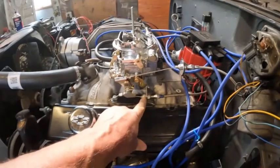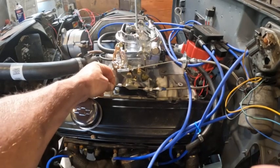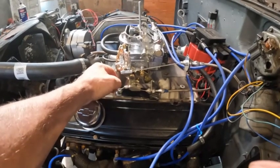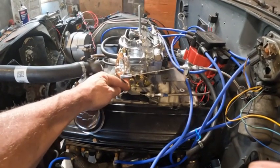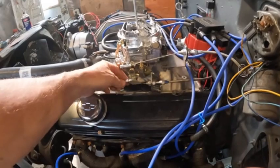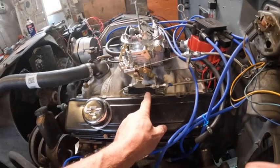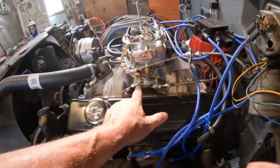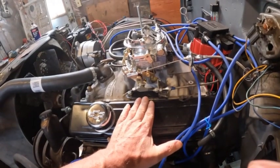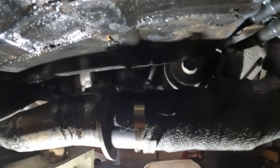I've adjusted this a little bit and tightened it up — there's a little bit less slack now. I could probably tighten it a little more, but at this point I'm going to stop adjusting without road testing. I just wanted to demonstrate how you move the pivot point to reduce the stroke, so you're at a higher starting point off idle for part throttle holding power. You still have to adjust the cable so it's fully extended at full throttle for maximum holding power.